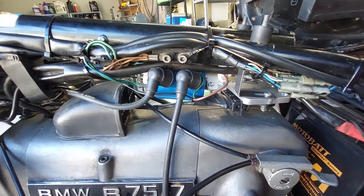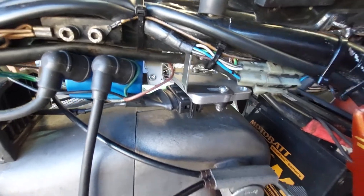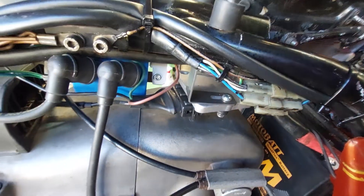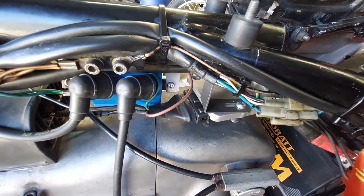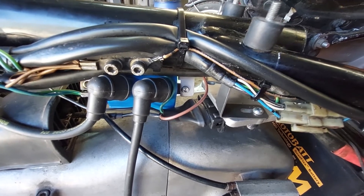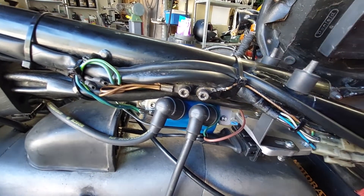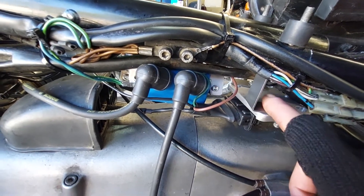There's the Dyna coil fitted up now. I actually wound up taking off the brackets that the other guy fitted and putting the correct brackets that come in the kit in. If you look down on that you can see it enables you to turn the module slightly and get it clear of the coil. The coil in this application is a little bit deeper than the original ones, but if you have twin coils there's a coil on each side — one goes on here and there's a corresponding bracket on the other side. They're a shortened Bosch coil.